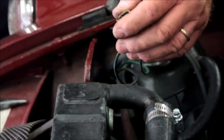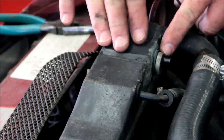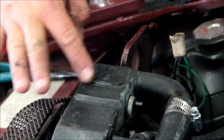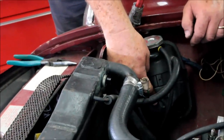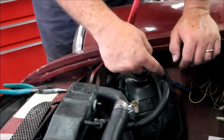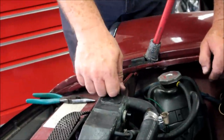Sometimes the switches aren't so good and sometimes the switches are old. It's essential for the switch to work that there's no air up in here. Remember that the coolant recovery system works in this way: any air that's located in here gets forced out into the bottom of the expansion tank. Then when the system cools and you're not running it, it draws fluid off the bottom of the tank up into here. The whole goal is to keep this full of water, because if there is air here the ERP switch will not close and the fans will not run.